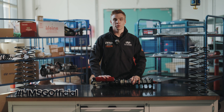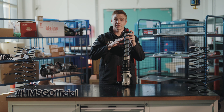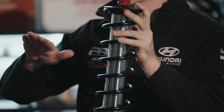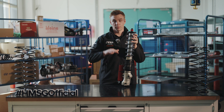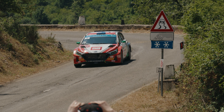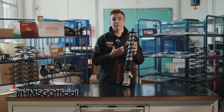The suspension works together with the roll bars and the chassis setup, and it's about getting the right balance across all of these. If you have a soft damper the chassis can be very unstable, moving a lot, but you're doing this to try and get grip in adverse conditions. To counter this, you can go stiffer on the roll bars to control the body movement so the driver still has confidence, while the damper is still soft enough to find grip. Or you could be soft on the roll bars to allow the car to roll and create inertia — which generates grip — but then want the damper stiffer to give support to the chassis. Driver preference varies; personally I want grip and traction but also chassis support to give me confidence to drive fast. A confident driver is going to be a fast driver, and that can overcome any lack of grip or traction.